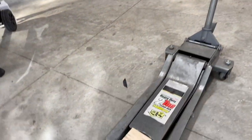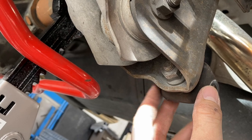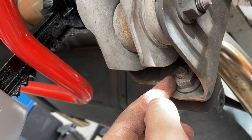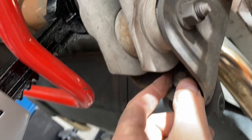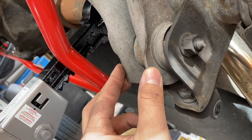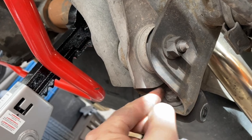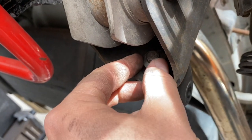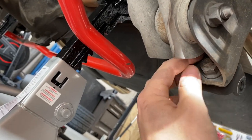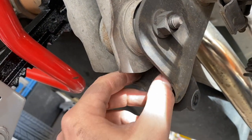Here's the first issue I ran into — pretty minor, just an order of operations thing. They tell you to remove this bolt first, which attaches the driver-side lower rear shock mount. It's a 13/16 — which is like a 21mm. If you have a 13/16 wrench, perfect, but most socket sets stop at three-quarters. I've got a 13/16 socket, but you can't get it in there with the shock in the way to reach the lower control arm bolt. So basically, the next step is to put a jack under there, undo the shock, slowly lower it down first — that way you can get access. Most people probably don't have a 13/16 wrench and it's just kind of awkward. Because of where I placed the jack stands, I can get an adjustable wrench on it, but it hits on the other side. So I'm going to go out of order — undo it, remove the spring, then come back.